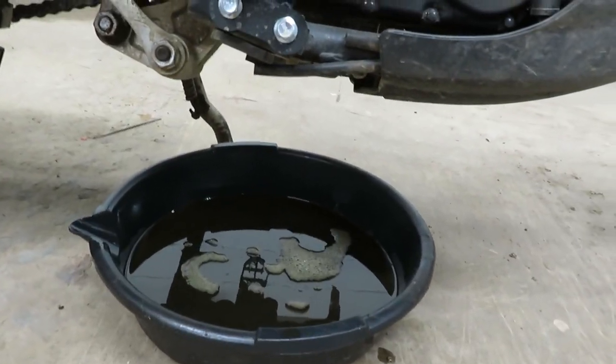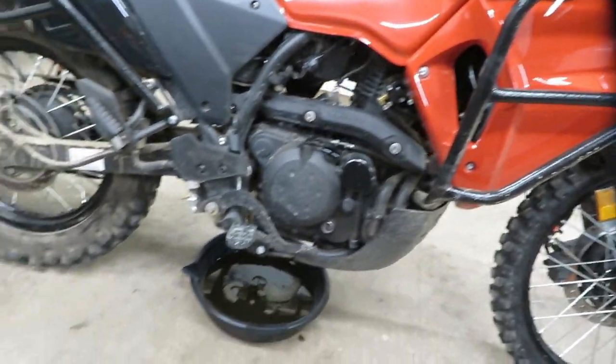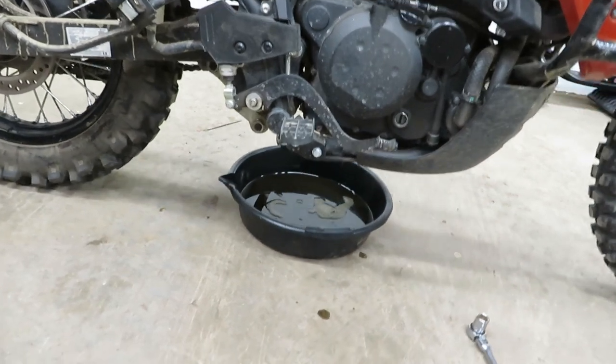All those additives in there are why I decided not to change my oil early. As soon as I got my low-profile drain plug I really wanted to stick it in, but Kawasaki puts this stuff in for a reason — it's supposed to be in there until you hit 600 miles. I would not pull it out early no matter what your oil looks like. It's starting to slow to a trickle, but I'll lean the bike over to get a bit more out.